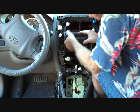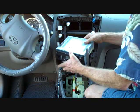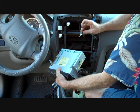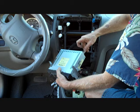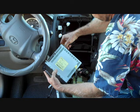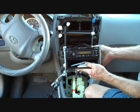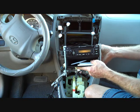Wiggle the stereo loose and it will come forward. On some models, if you have a dead stereo and you've checked all the fuses, there's usually also a fuse on the back of the radio — this one doesn't have one. The antenna is just a press fit; grasp the base and it releases. The main connector to the stereo has a trigger — squeeze that trigger down and pull the connector loose. This is how you remove the stereo from a Hyundai Tucson. Hope this video has been helpful — please subscribe, thank you for watching, and see our website if you have any other problems.